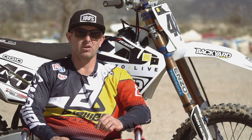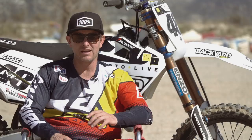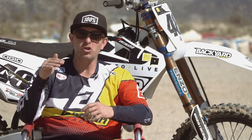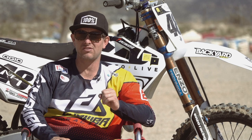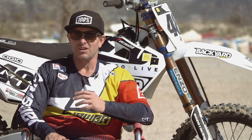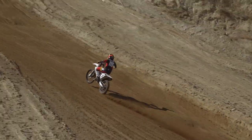Overall, we got what we wanted. It didn't change the character of the Husqvarna to make it feel like a Yamaha — which is essentially what these forks are, as close to a KYB Yamaha fork as you can get. It still feels like a Husqvarna in a good way, but it adapted some of that KYB technology. It ramps up really quick, early. I would probably take a little oil out so I can get a little deeper in the stroke, because the control of this KYB fork is so good. Don likes to do big air wheelies and overjump stuff sometimes, but I like to catch the backsides a little more. So I'd drop the oil a bit and back up the compression so I could get in those turns a little quicker without it being so high. But overall, the feel is good — the comfort is better and the control is better.